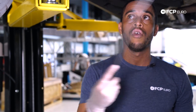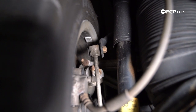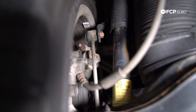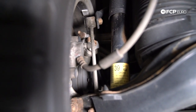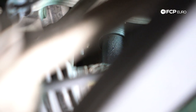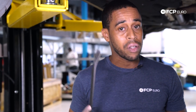The last thing you want to take a look at is the shock absorber. What we noticed on this car is the shock body on this side is dry, but on the other side there's a lot of misting. Misting is not necessarily an indication that the shock is blown out — with the piston stroking the way it normally does, sometimes you have that oil mist, which will also attract dust. So it's going to be a combination of a visual inspection and how does the car feel while you're driving it. If it doesn't feel well damped in the rear and it's bouncing really hard, replace both shock absorbers.